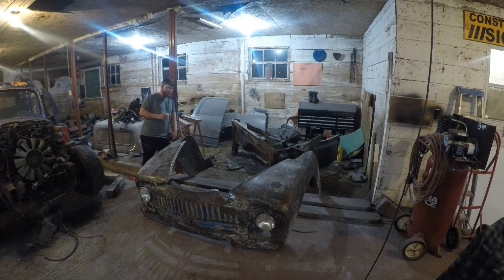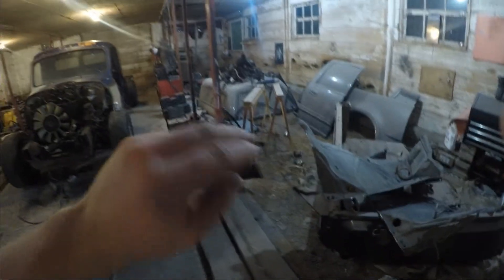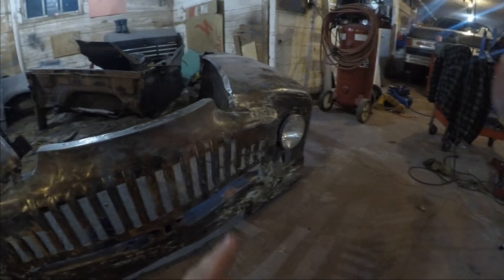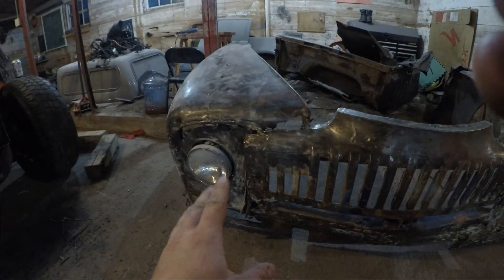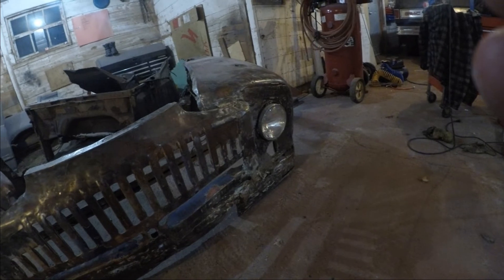We have blowout on this side, that side, the front end — there's pretty much blowout everywhere. It's about as sturdy as a spaghetti noodle; it's not good. We need to basically completely rebuild these two front fenders, mostly the front clip. There's a rust hole there, we have to patch this whole fender, rebuild basically from here all the way down and duplicate that on the other side. Whoever worked on this used old-school braze, lots of fiberglass, lots of bondo — extreme bondo. It wasn't good.